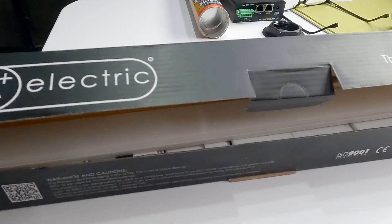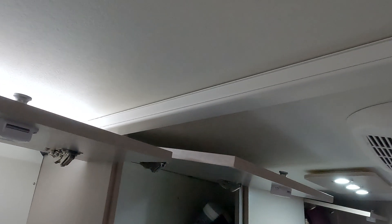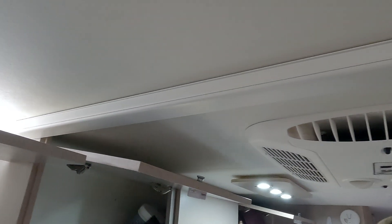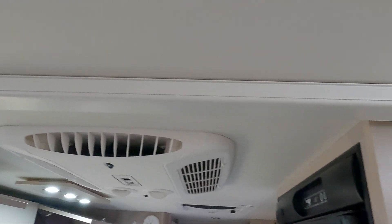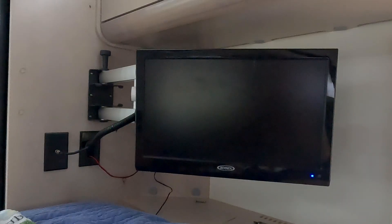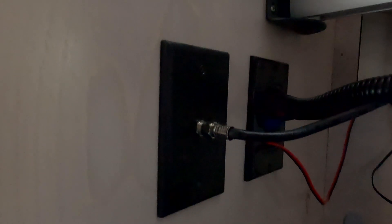I'm going to come into the cabinet and then run it along the top. There's already a white beam — I believe there's a steel beam to hold the camper together — and the TV is over on the right. I'll tie into the 12-volt system that's feeding power to the TV, so this will be running off my batteries.